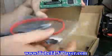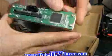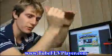This connector goes to your motherboard using your existing hard drive cable, and then you use the additional cable to go out from this unit into your hard drive. The chipset on here — it's a proprietary-looking chip that just says Silverstone on it — handles the logic that allows the HDD Boost to decide whether to write any particular piece of data to the SSD or the hard drive, and where to read it from. Basically, the HDD Boost treats the SSD like a giant cache — one tier down from RAM. So you've got your CPU, CPU cache, RAM, SSD, and then the hard drive. Thanks for watching the HDD Boost unboxing, and thank you to everyone who participated in the Easter Extravaganza.